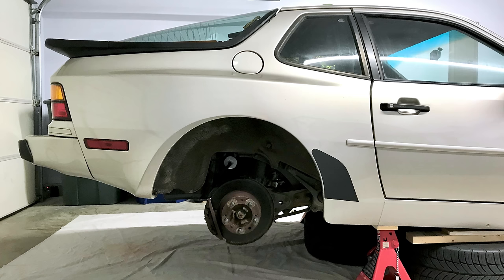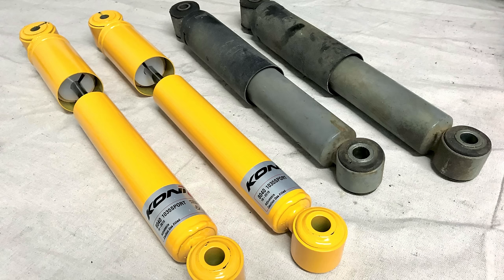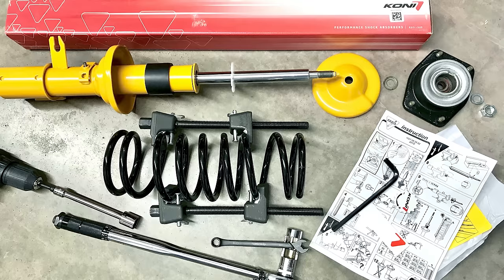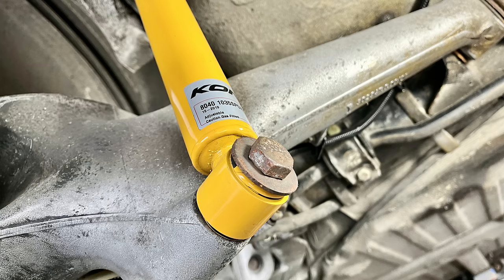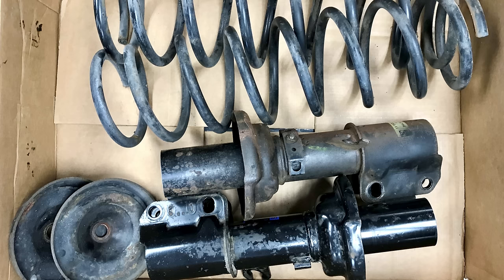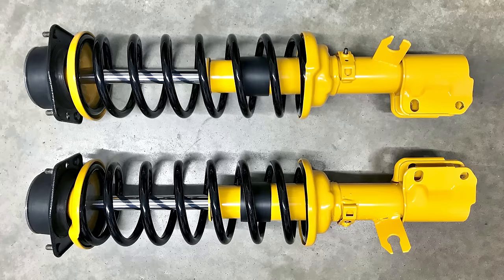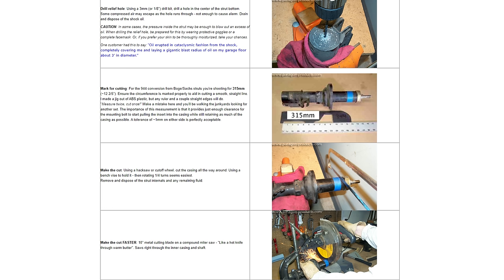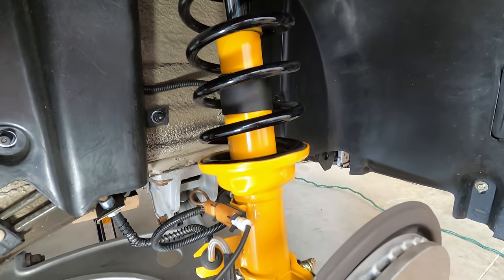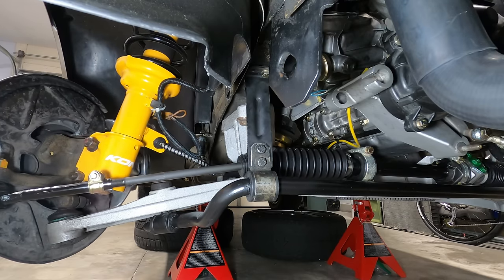When the original rear shocks on the car failed, I replaced them with a set of Koni Sport adjustable units, which were available as a sport suspension package at the time through Porsche option code M030. I later matched the rear shocks with a set of Koni Sport inserts up front to complete the package. While the rear shocks are quite easily swapped out by removing just two bolts, the front setup is much more involved. A challenge with the later cars like this one is that they were delivered with sealed struts up front, and since the Koni sealed struts are no longer in production, a front strut conversion is required, where the old strut housings are drained and modified to accept a set of shock inserts. Even at their softest setting, the Koni shocks are a little firmer than the base shocks, but the ride quality isn't what I would call harsh or overly stiff, and the adjustable damping allows for some customization.